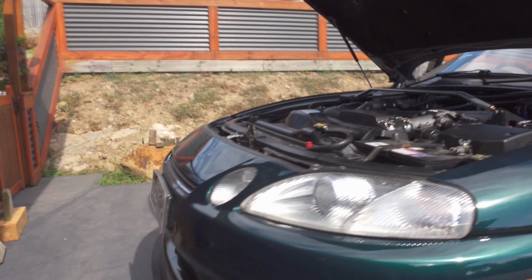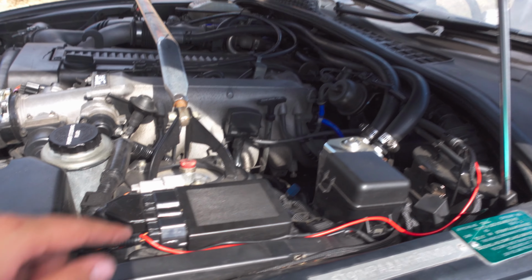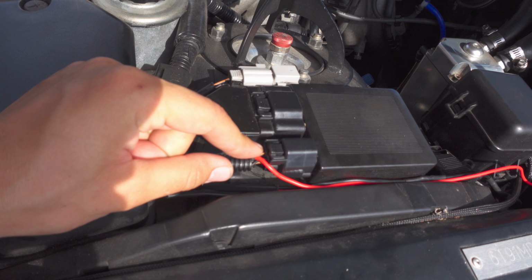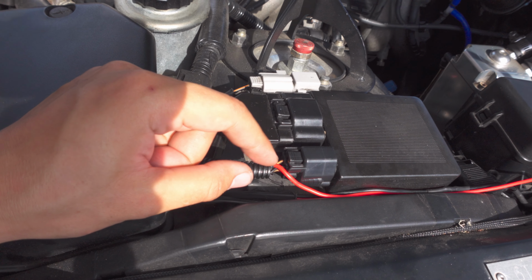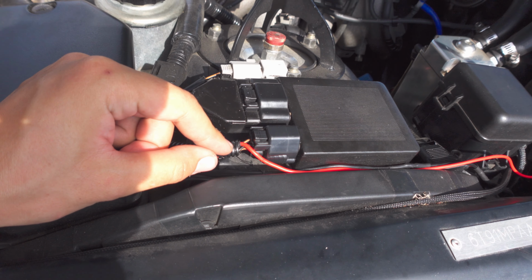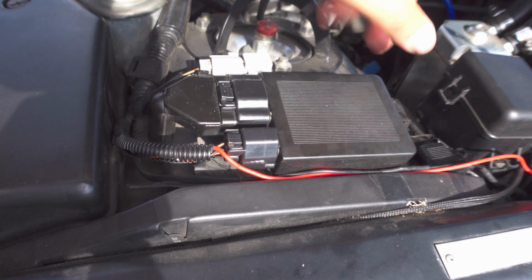So just kind of wrapping up with the build now, not a lot left to go. The wiring has now been done. It's still kind of loose hanging down in here, but it's all tapped in, which is good. For power, I tapped into the igniter box, this pinout 2 with the black and orange wire is a plus 12 volts to the battery, but it's only switched on with the key in the on position. Then ran that down through there. I still have to tidy all of that up, but the wiring is done.